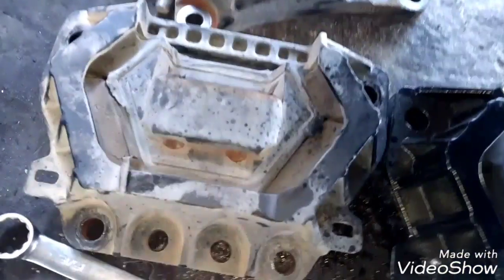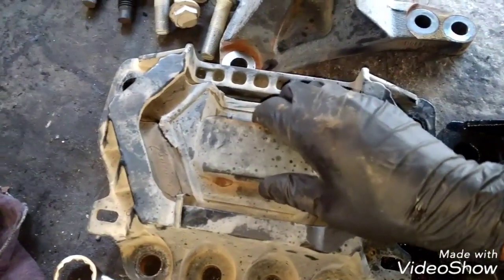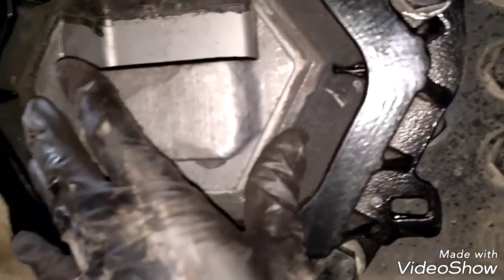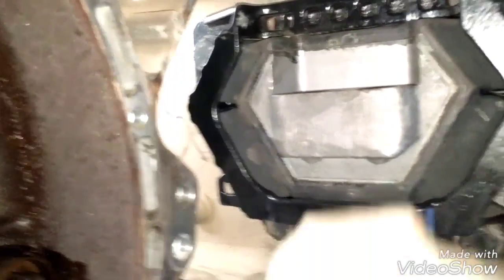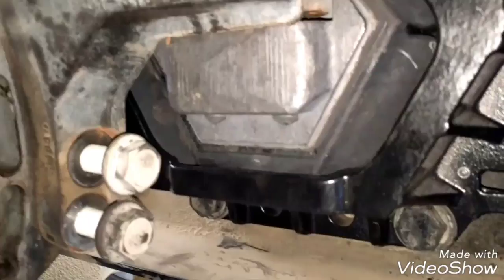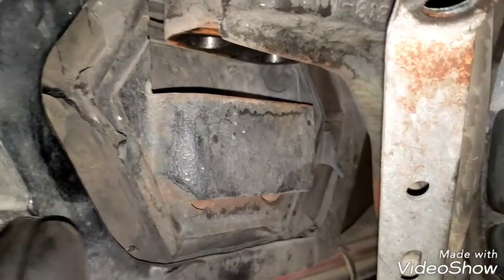The motor mount is removed. I have it right here — it's all broken, as you can see. I have the new one here so we're going to install this one. Motor mount is in place. Now we are going to tighten the bolts to hold the motor mount in place. The motor mount is in place. Now the next step is to place this bracket. The bracket is in place, but before we tighten the bolts, we need to insert the engine motor mount support bolts and start them — because if we don't do this right now, later it's going to be really hard to install them. The motor mount, the bracket, and the bolts are in place but still loose — don't tighten them yet. Now we're going to tighten all four bolts, and after that we're going to do the same process for the driver side motor mount.